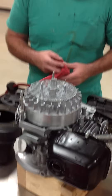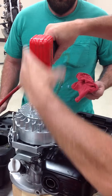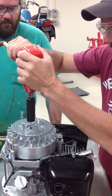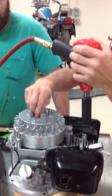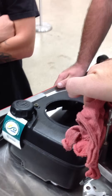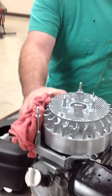He's simply going to put his impact on — this is standard thread — and go ahead and remove that center nut. Now that was torqued on there fairly tight, not necessarily to the 55 foot-pounds, but you're seeing the example here. The reason we don't want any hands or rags in place right now: our big fear is on these studs. If we hold a rag up in there and it wedges around and grabs your finger or something else, it's going to be a bad day.